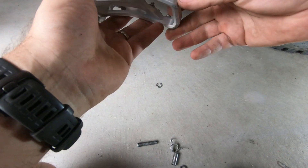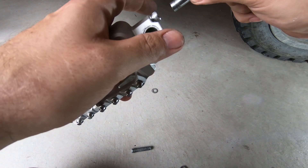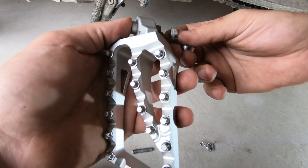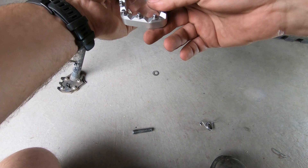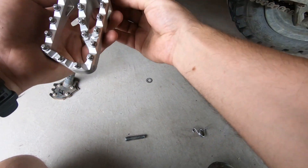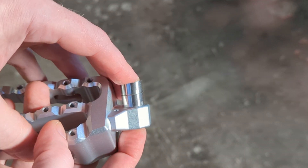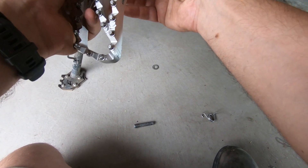Next, we're going to get our Alt-Rider peg installed — logo facing forward. Start by getting the 29mm stainless steel bushing and inserting it into the foot peg body. Here we have some options: you can do both 6mm spacers on the bottom, which will raise your foot peg above OEM height; one on top and one on the bottom for OEM height; or both on top for a lowered foot peg. I prefer to keep it at stock height, so I'm going to do one on each side of the peg.